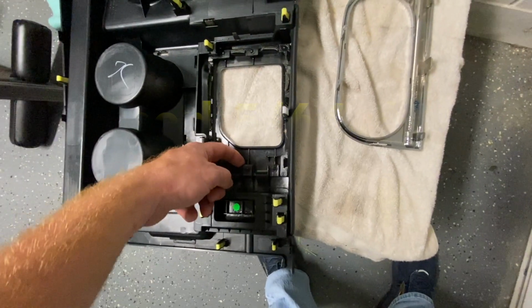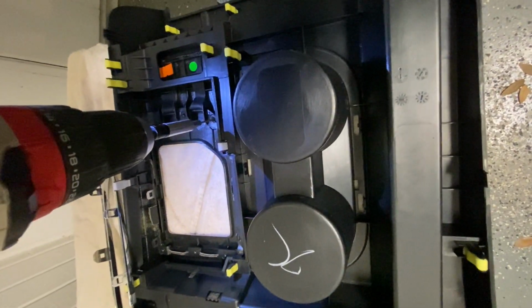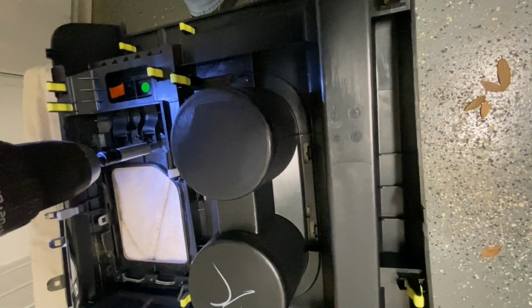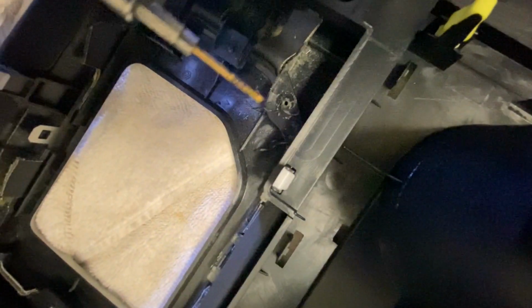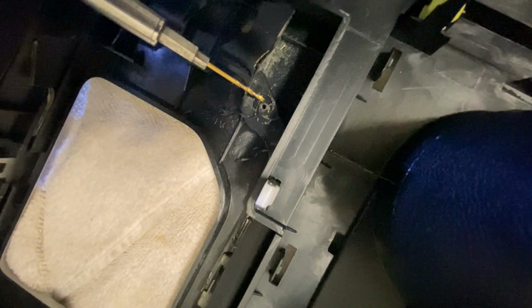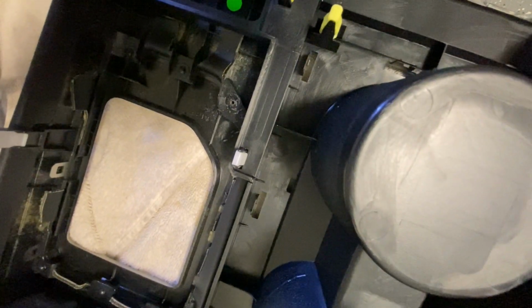And so I'm just going to drill these out. You can see here I've actually started with 5/64, and I'm just going to drill that a little bit, that far, and then come back out with it. If you look, I'll brighten the light right there. There you can see the little hole that I put right there. We're going to go ahead and do the rest of them, this little 5/64 size.